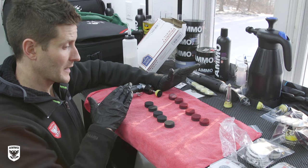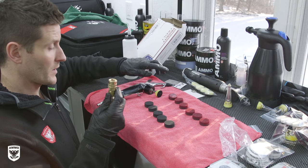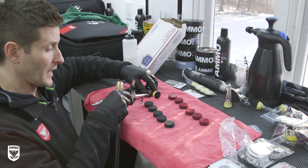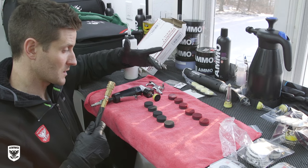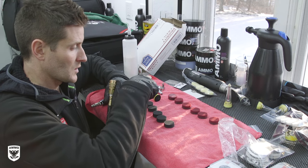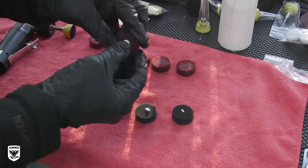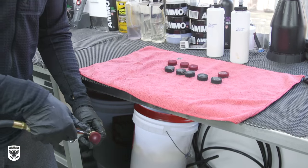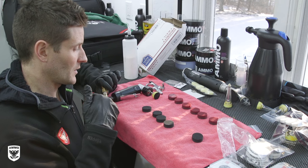After talking to Kevin and playing with the trim, he's absolutely right — the pads are filling up really fast and I have to blow them out constantly. The tricky thing is I only have one air hose. When I plug the polisher in, after about 15 seconds the pad is full. I have to unplug it, blow it out, and put it back — it's a little cumbersome, double the annoyance. So the plan is to pre-prime as many pads as I'd need, blow them out individually, then just swap them in as I go and clean them later. Refining with tiny pads is very, very challenging, tedious, and time-consuming — know that going in so you can prepare ahead of time.